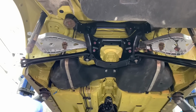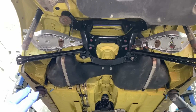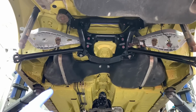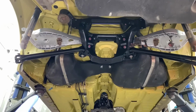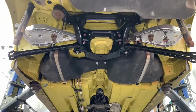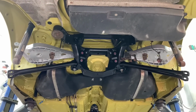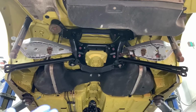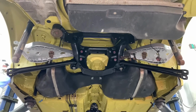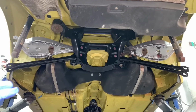and through any of the little vents around the jacking point, because we've done significant structural reinforcement work inside the jacking points, and any of the little boxes where the fuel tank brackets are, and the V-brace mounting boxes, and then the chassis legs. Just a general good protection inside, just to benefit the internal sections, because obviously we can protect the outer section with this paint finish, but we cannot do that on the inside. You can't spray paint or seam sealer inside, so you have to do it with wax.